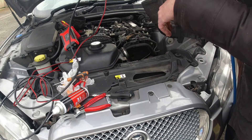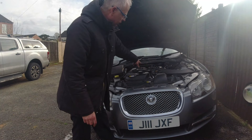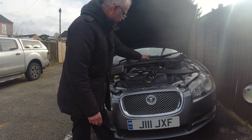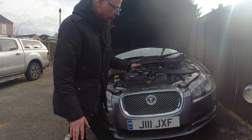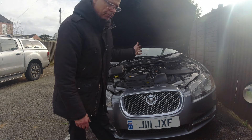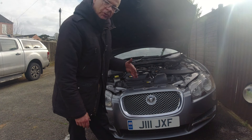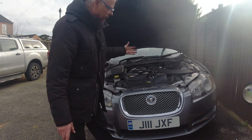It's all back together again. I did one more leak test over here on that sensor I had cleaned before. I haven't put the engine cover back on top just yet — I'll probably have to take it off again shortly. I've cleared the faults. It's still got the DPF fault on there but the other ones have gone. I'm going to take it up the road quickly, as the restricted performance light usually comes on very quickly, and I'll let you know what happens.